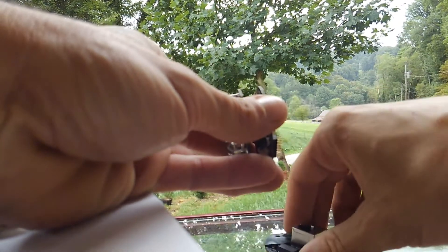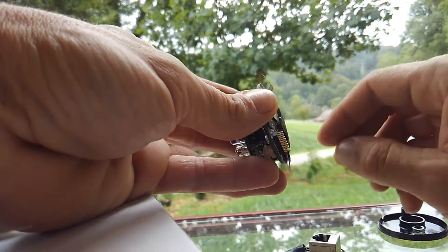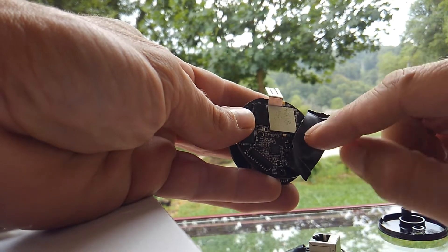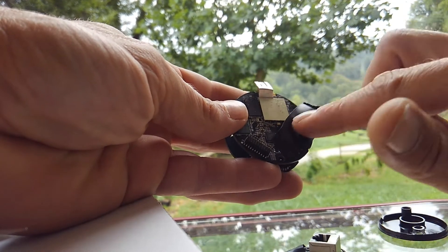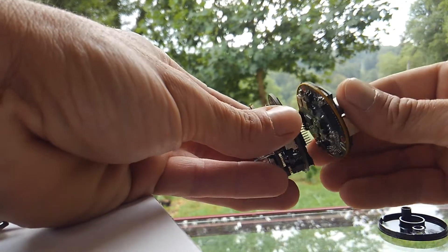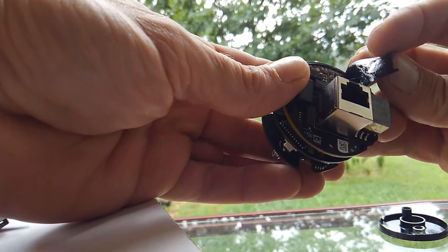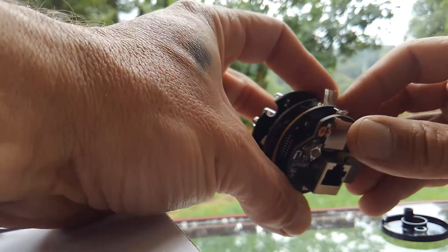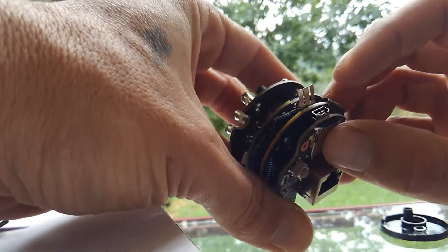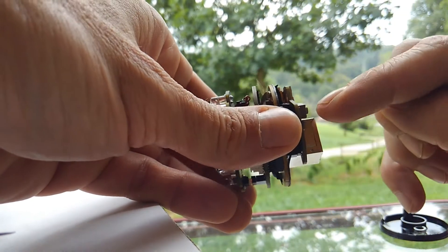At this point you're going to have your USB board, your network board, and your main camera board. I put some tape over this capacitor/resistor to keep it from shorting out when I put the board back together, and then a piece of tape over this portion of the board to keep the USB from shorting out on anything it might hit, because you're going to be powering the device up as-is.